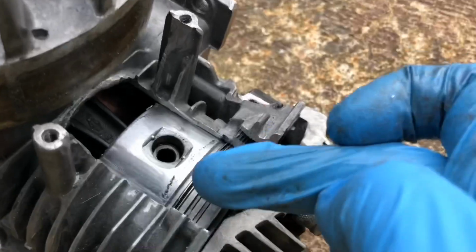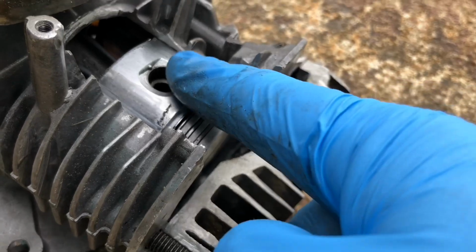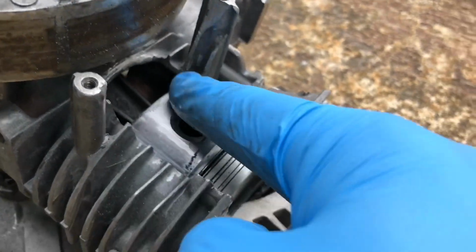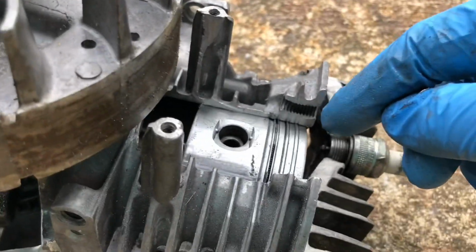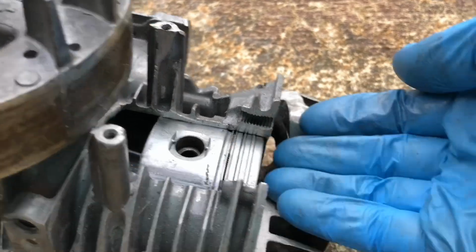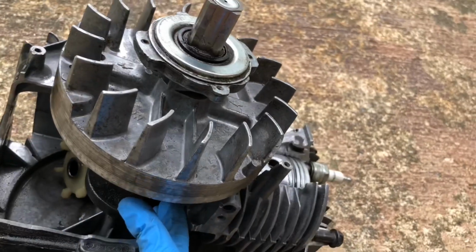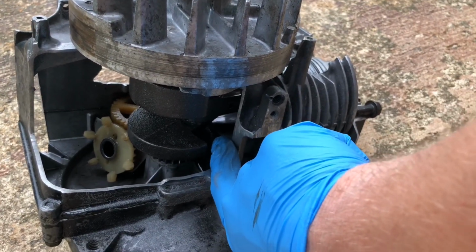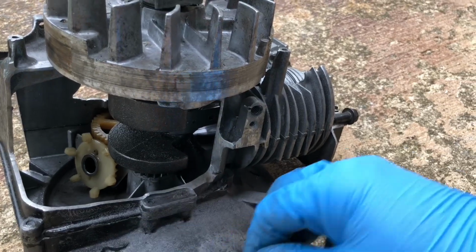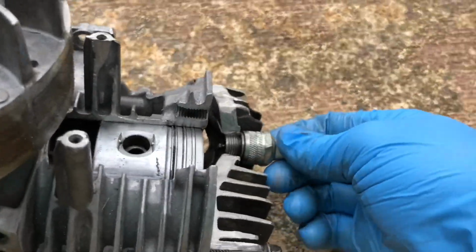And then you've got these piston rings right here, and they are designed to scrape the oil down into a very thin film, so there's just enough to lubricate the piston's cylinder. And they're also designed to keep the air and fuel up here at the top end from squeezing past and getting down here into the crankcase where they're not supposed to be. Because if they get down here, they're not really going to be burned without ventilation, which they do have, but it's best to just keep it up here in the first place and not have to worry about it.